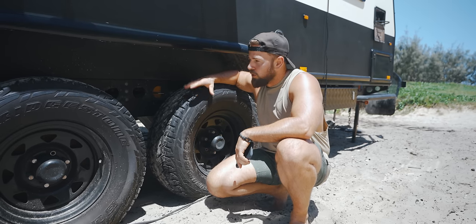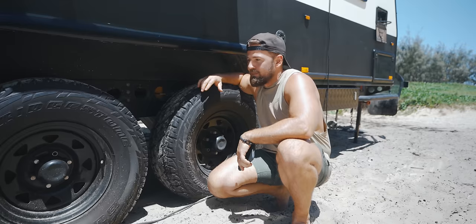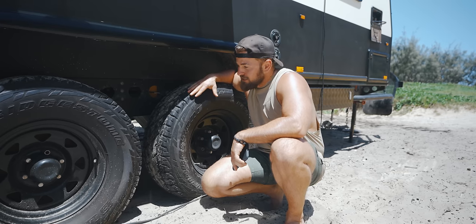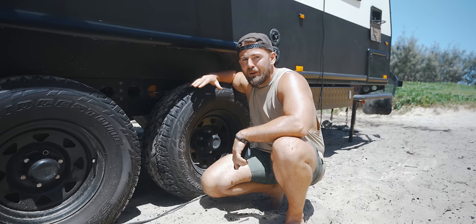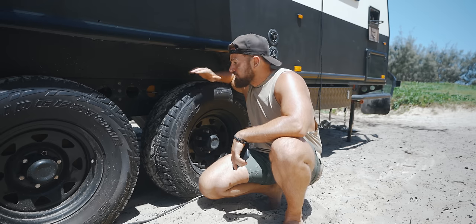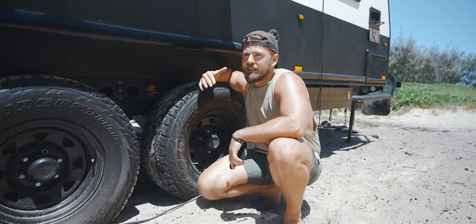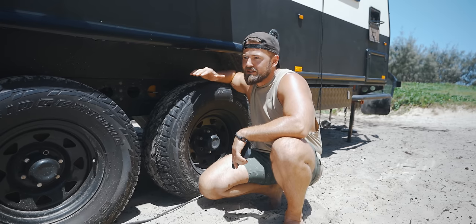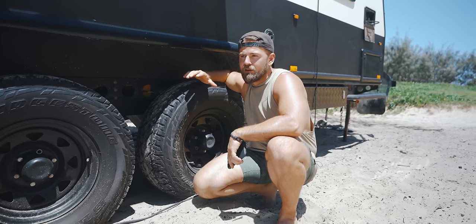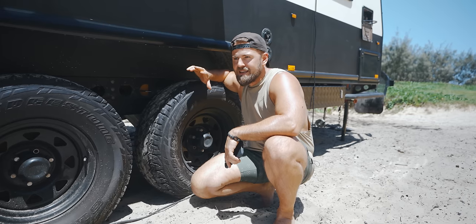Our wheels are Bridgestone all-terrain light truck tyres. We've had the same set on for two years and the tread is still really good. It comes with two spare tyres on the back, and we've only had to swap one tyre out when we got a screw in one on the Oodnadatta track through Australia — these tyres have been perfect. The braking system is a fully electric Alco drum brake setup. We've got a controller in the car to adjust the brake level; we usually cruise at six or seven, cranking up to seven or eight on heavy downhills. When you first get a caravan brakes will be tight, so start at three or four and increase over time as they settle in.